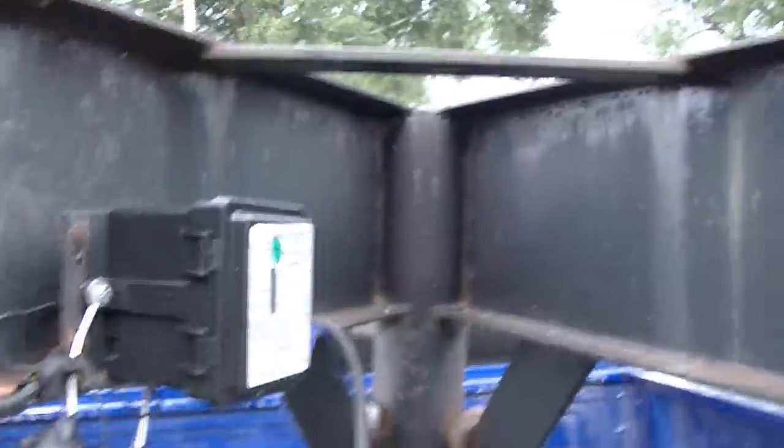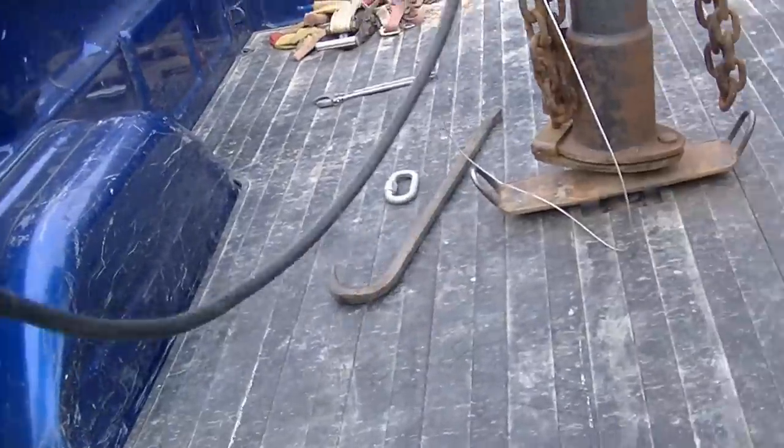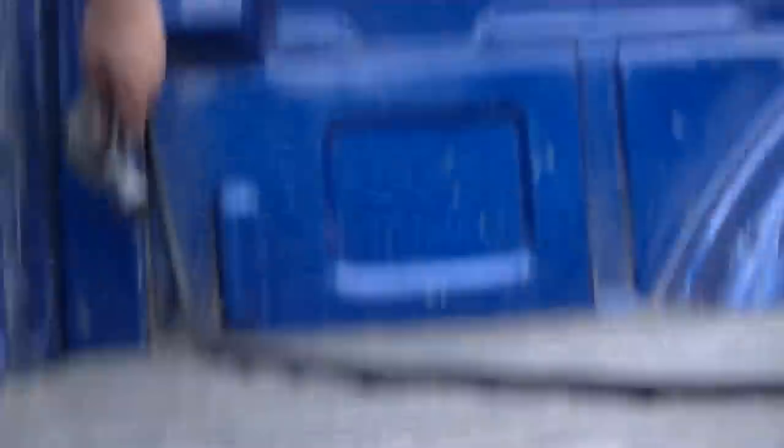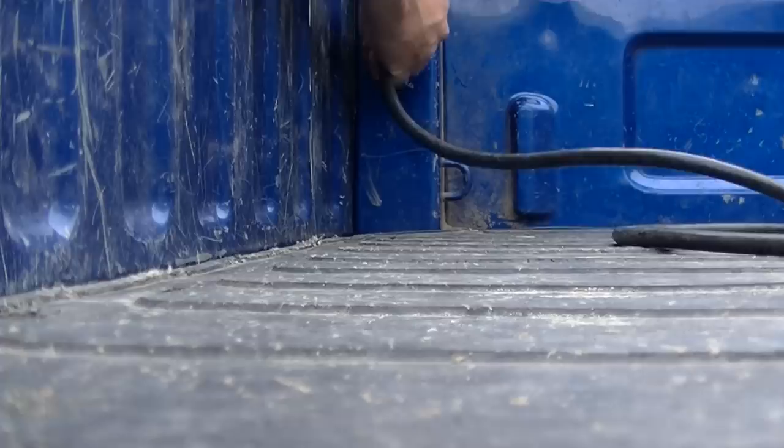The next thing you've got to do is get in the back of the truck. You're going to have to have somebody hop up — it's usually the youngest person who's with you. We have to hook this up. What this does is it controls the brakes from the cab inside the truck and controls the lights and turn signals. These connectors come in different shapes and sizes, so they vary by truck and trailer. Always make sure you have the right one before you go to hook up. I'm going to lift up on this and stick her in there, make sure she's locked in.